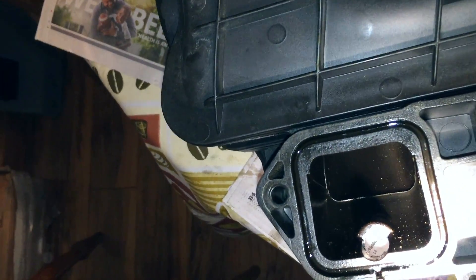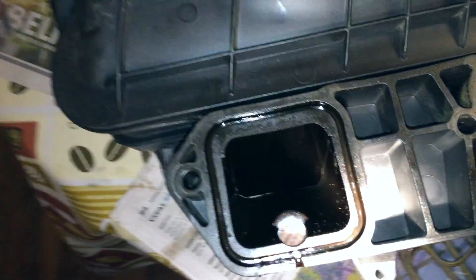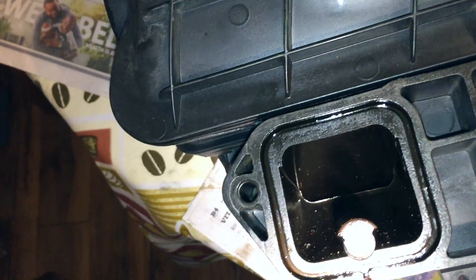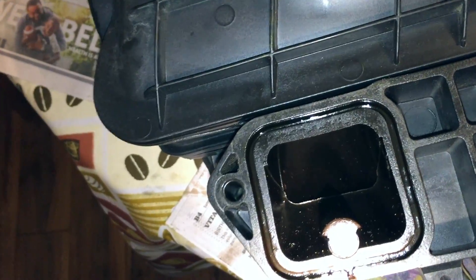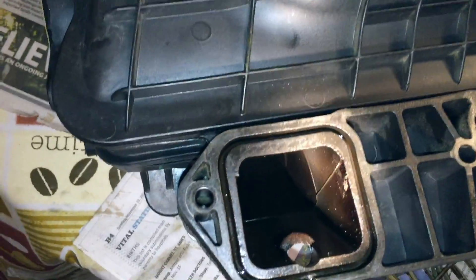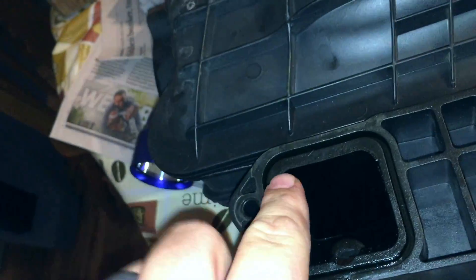That's the one thing about a catch can that helps. You can see down in there — you see the plastic extrusions. I've got to remove those little extrusions. They kill your horsepower just a little bit, create turbulence, and just don't ram as much air down into the cylinder as you'd hope.